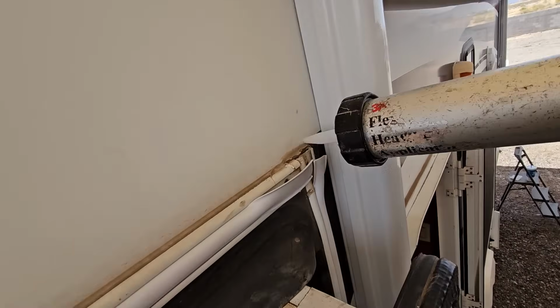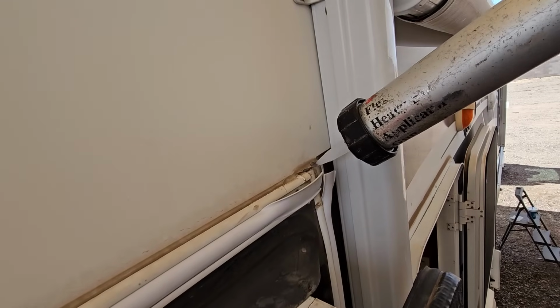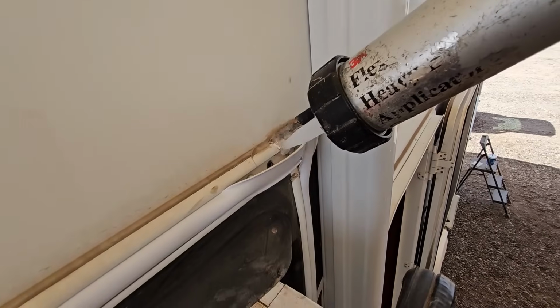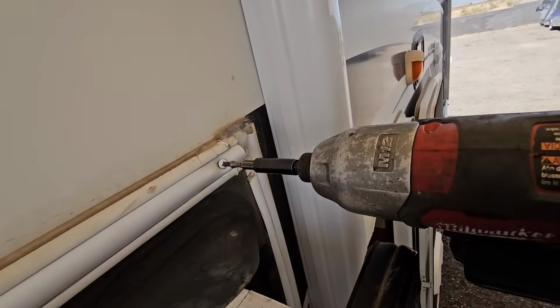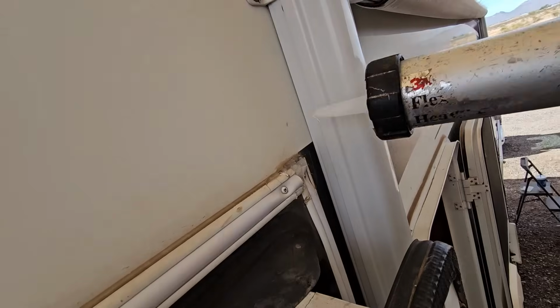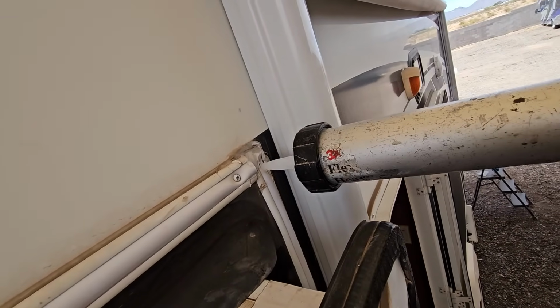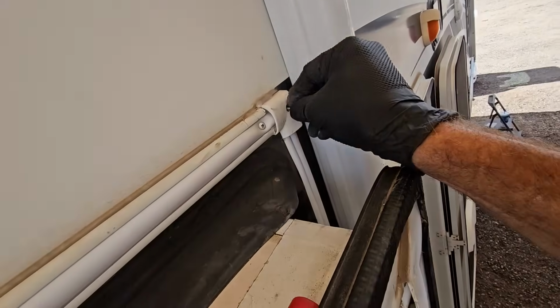Now I'm just going to use some clear silicone to help redirect that water. Get that edge right there. Fill this and load that up pretty well. None of this is ever going to be seen. Top for good measure to seal it all off. And we can go ahead and put this cap back on and actually use a long screw this time so it's going through everything.